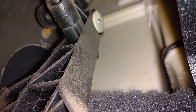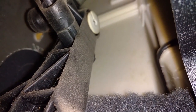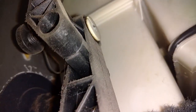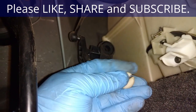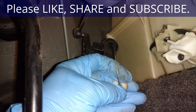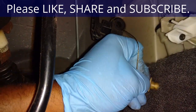Next, I'm going to pull that grommet out and push that throttle cable back through there. That's the other end of the throttle cable. So let me see if I can get that grommet out. I just pulled it out. I just pulled that out of the accelerator and I pushed the cable out of the plastic piece like that.